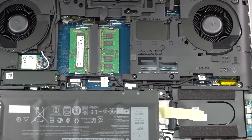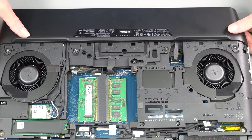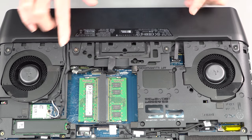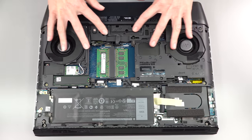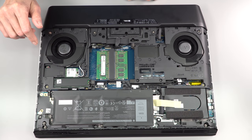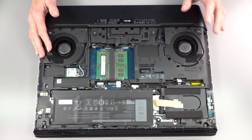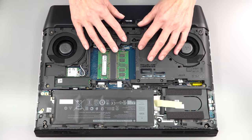To go further inside, remove the rear aft cover where the Tron lights are by undoing four shiny screws — two on the rear edge — then slide it off and remove the shroud screws. Underneath, CPU and GPU cooling are separated, preventing heat pollution between the two. To repaste the CPU or GPU, you'll also need to remove the Wi-Fi card and disconnect the battery. For a detailed teardown, see our original Alienware Area 51M review linked in the description.